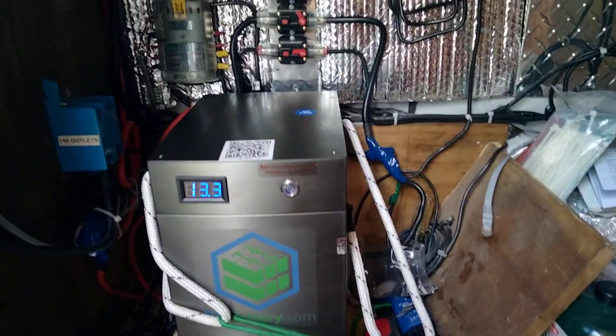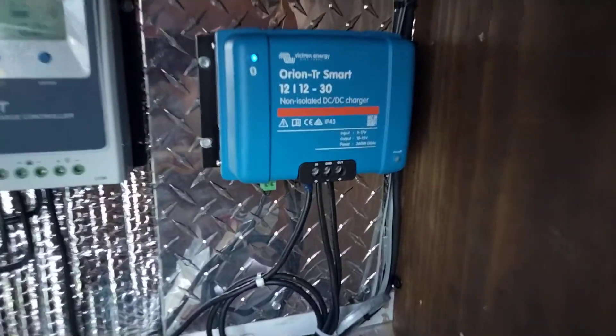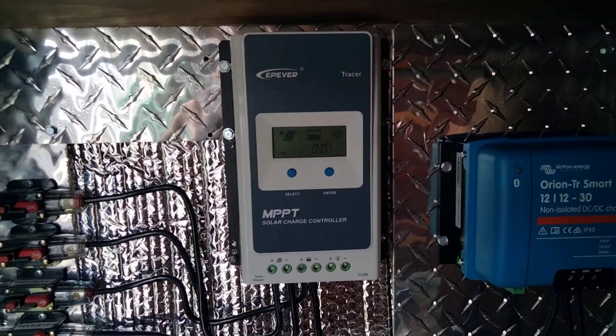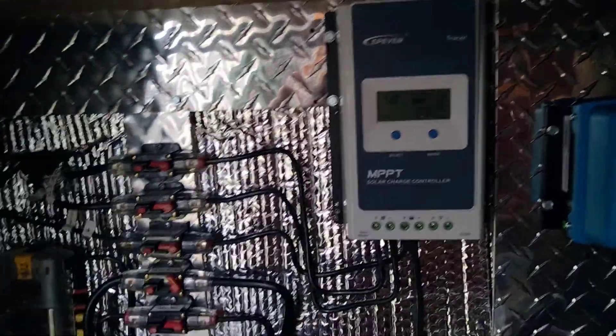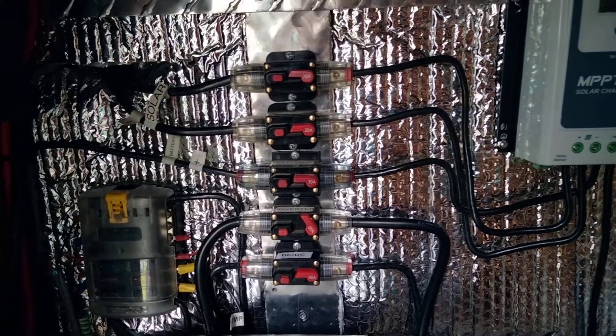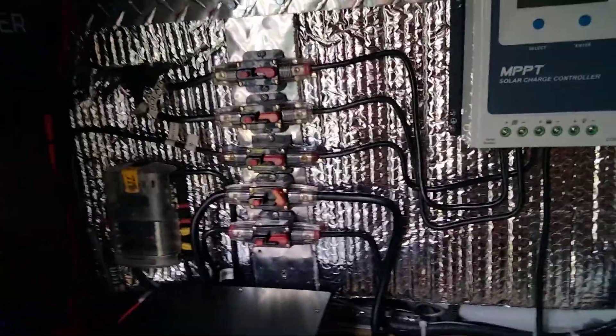Here's my off-grid setup in the camper van. I went with the big battery — 202 amp hour lithium-ion — and I've got my 12-volt panel, six circuits, 1000-watt inverter, DC-to-DC smart charger, and my MPPT solar charge controller. I've used EPever in the past and it's been reliable. I ended up using breakers for a stereo system and they've worked well — real cheap, never had an issue.